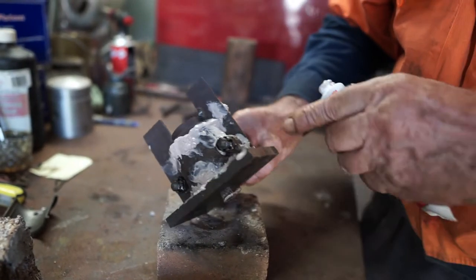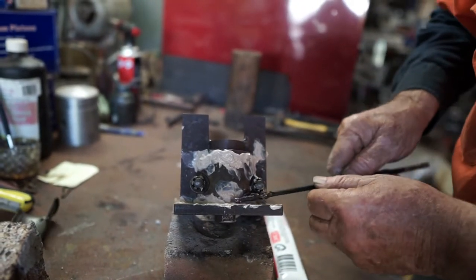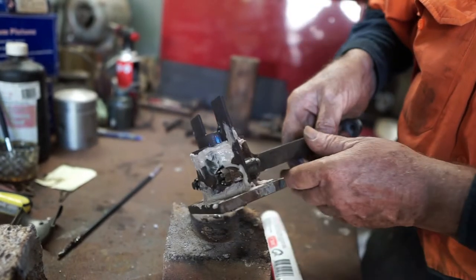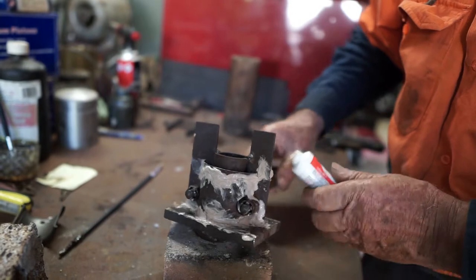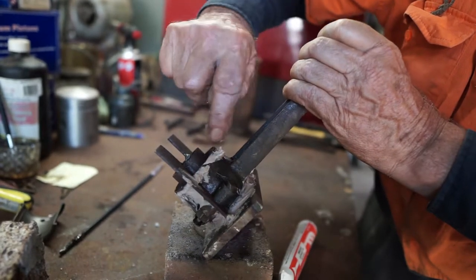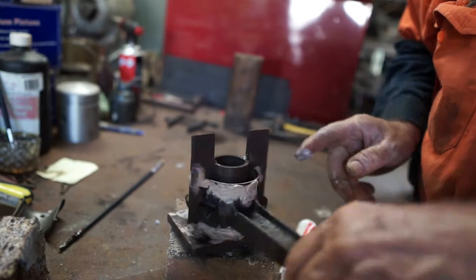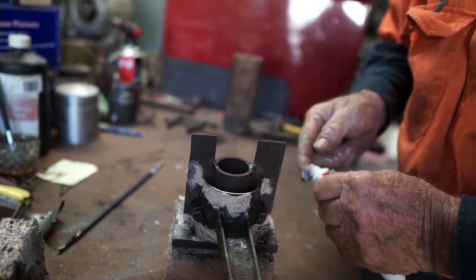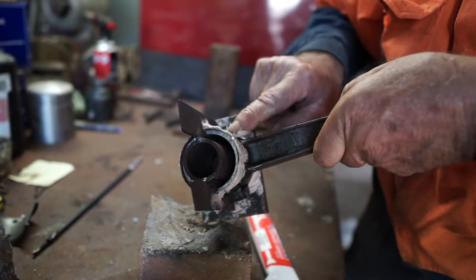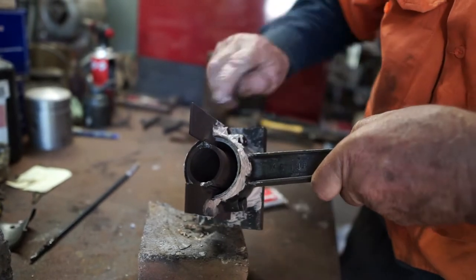It's still pretty soft but you can see it fits in there. What I did — I used the back of the paste brush and just got in there to shape it. Went right around the lugs there because we don't want any white metal coming out of those when we start to pour. It's fairly fluid — it'll flow down a thread — that's why it's important to get all these just covered up. The muffler putty is a very good sealing agent, provided we've got it over the surfaces. Just put a little bit down in the bottom there, make sure it doesn't leak — best to get it now.